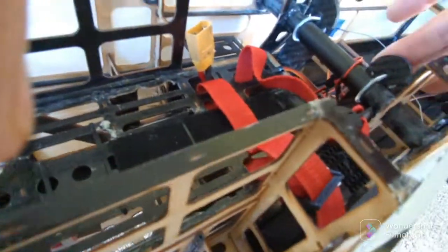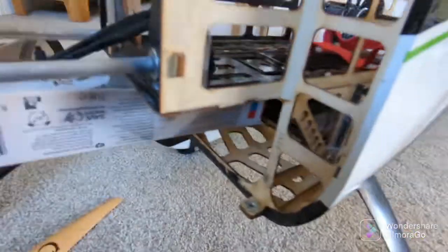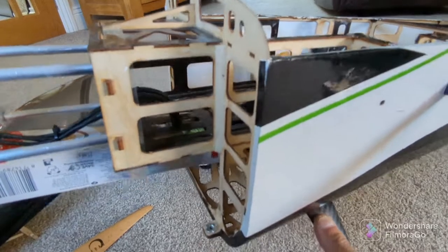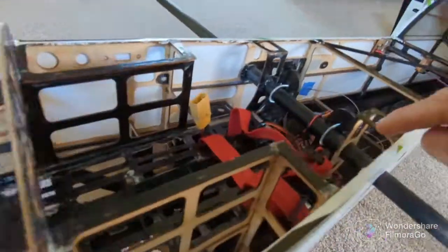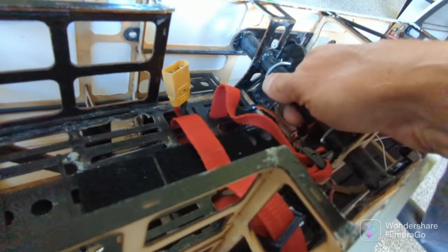And the reason being is they go down to, if you look in there, they bolt to this angle iron inside here, this aluminium angle iron. I don't know if you can see it. They bolt to that on either side. And what that's for is the pressure from this, when it goes down, gets transferred to this wing tube, because that's the strongest bit of the aeroplane.